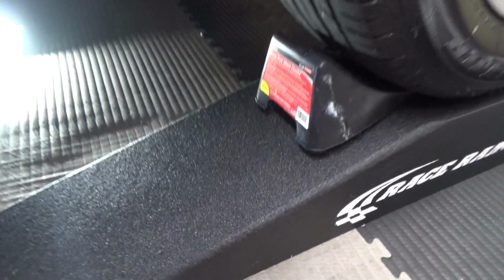So we're going to go underneath the car and we're going to have a proper look at what we have to deal with. And so here's the transmission. So the idea behind all this is to ground the battery to the transmission and then back to the brackets that are holding the trailing arm bolts in.